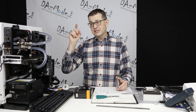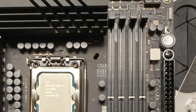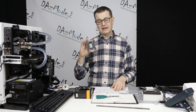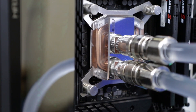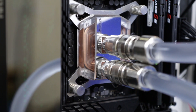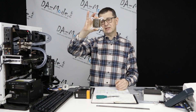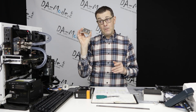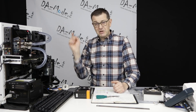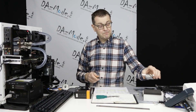With the new type of motherboard, especially ASUS, you can see they drilled two sets of holes - one that works for old coolers and one specified by Intel. In this sense the backplate plays an even bigger role for proper weight distribution, so I recommend using it. One more thing: in the past you could mount HeatKiller with the long sides on the sides and short sides on top, or rotate it 90 degrees for tube routing. With this motherboard you can't do that - there's so much stuff around the socket that it will interfere. The only way to properly mount the block is in the standard vertical position, not turned 90 degrees.